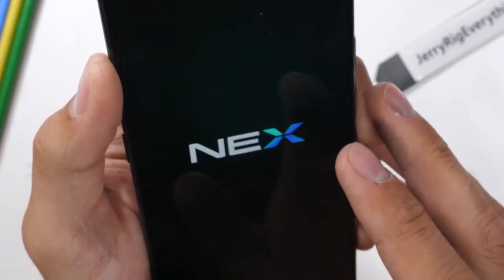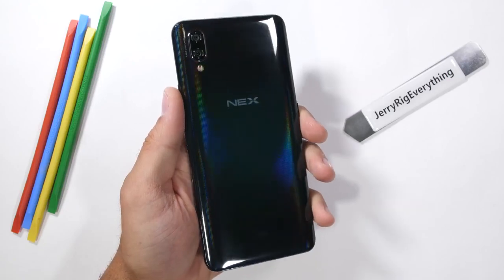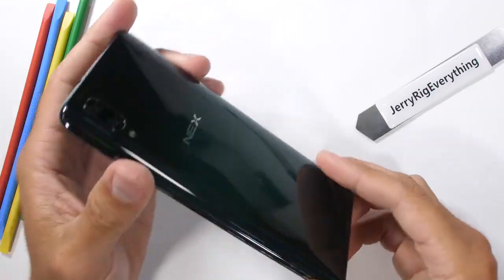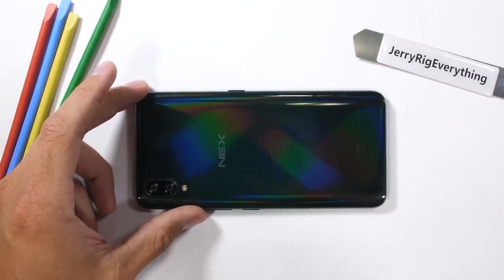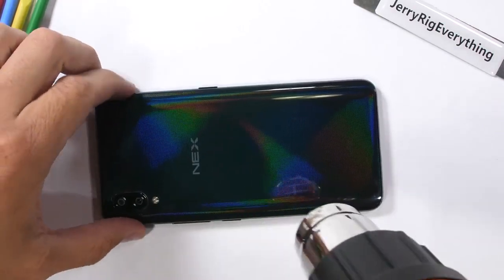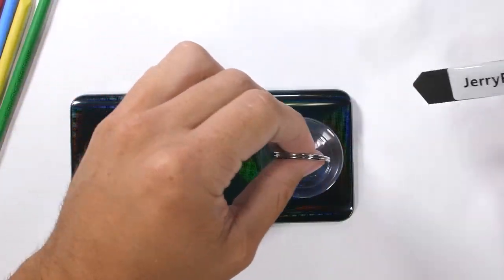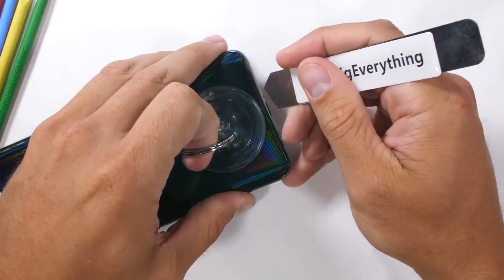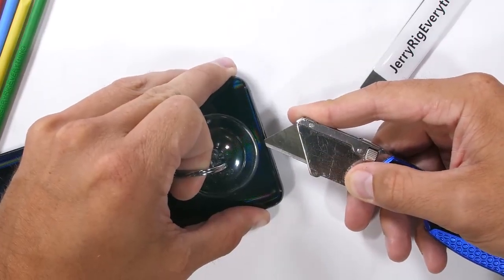The psychedelic coloring on the back panel is pretty stunning — all the different colors reflecting at different points on the black back. I almost feel guilty about my plans to dissect and modify the internals. Almost. Like with most glass backed phones, the glass removal is pretty standard. Our heat gun warms the little guy up, and a strong suction cup and metal pry tool commence the initial penetration while slicing through that still warm adhesive.